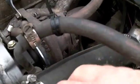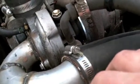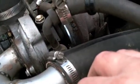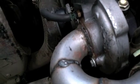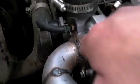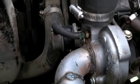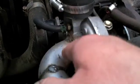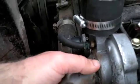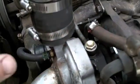I'm drawing through the carburetor. This is marine-grade fuel hose. It was supposed to be a brass wire braid, but it turned out to be steel wire, which made the bends quite a bit more difficult — a little heat and we got her. I threw this wonderfully welded little piece that I made onto what is actually the waste fitting for a garbage disposal, which for whatever reason turned out to be the right size. Welded to that, and that is the intake side, the suction side. I've siliconed it — I've got a washer and a gasket, and I siliconed the gasket, and put additional silicone around it because it's drawn pretty hard under vacuum. It just seemed like a good idea.